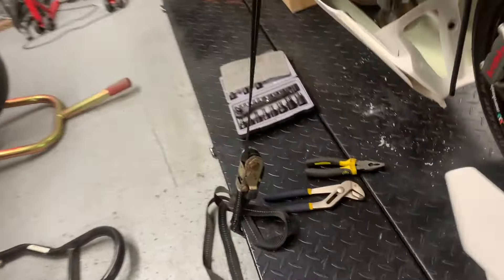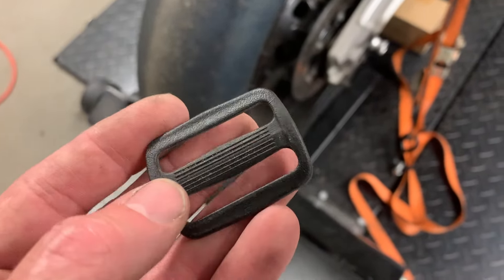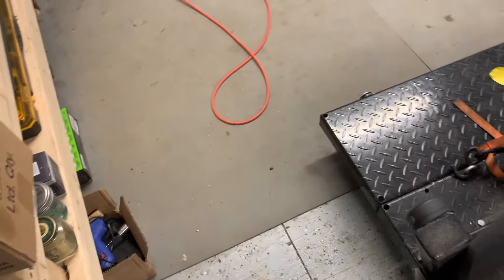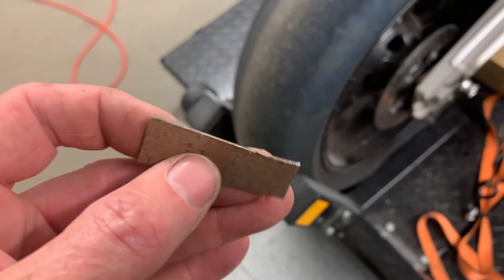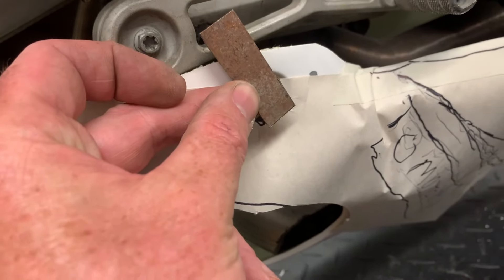On this side there were no recesses for the holes, so I just marked them where they were on the other side. On the back here there's no mounting tab — somebody had a plastic buckle for a nylon strap bolted to the frame and the fairing was bolted to that. That's just not going to work, so I've got a small piece of metal here that I'm going to drill, clean up, paint, and use as a mount. It'll get bolted on the back inside there.